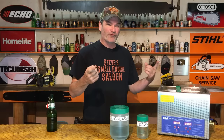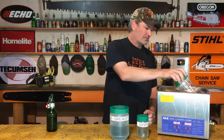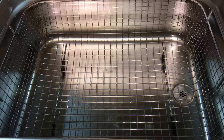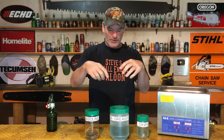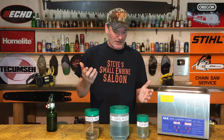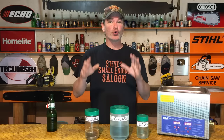Here's what I do: I take a container, put a part in there, screw the lid on, and put it right in the ultrasonic cleaner. Those ultrasonic sound waves go right through the container, cleaning what's inside. I fill my ultrasonic cleaner up to the fill line with nothing but water, and then I just use different jars — Dawn dish soap, concentrated degreaser, gasoline. I'd love to hear your ideas too, so leave a comment. I wouldn't use my dentures or hair brushes in gasoline — that's why I keep different containers.